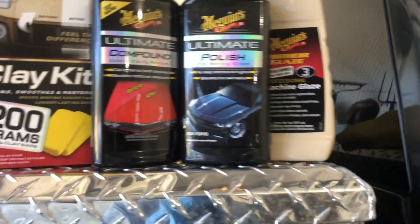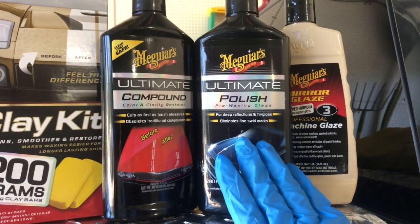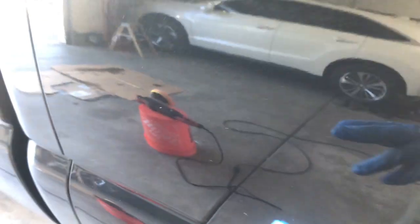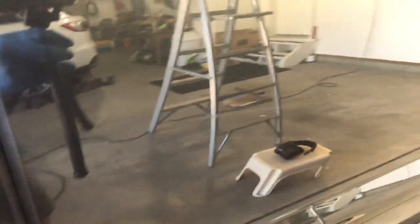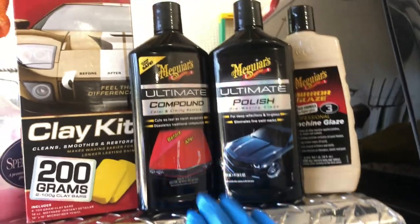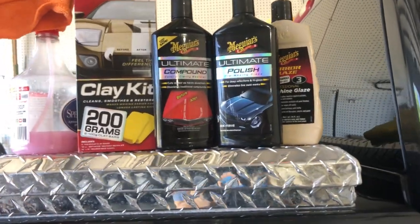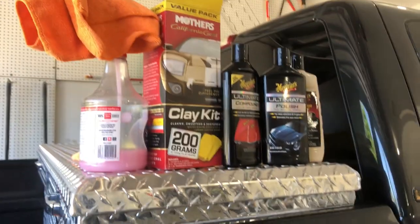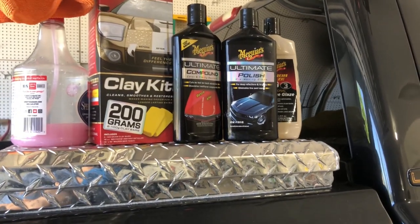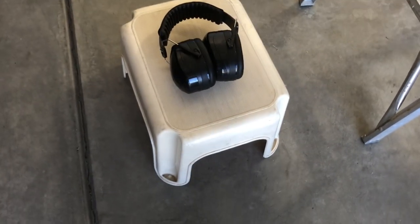There's also heavy cut and stuff like that for really bad scratches, but this truck is in pretty good condition so I've mostly just been doing polish over the whole thing. But if there's a place with a really bad scratch, like right here, that's where I might want to use some compound first and then go to the polish and then the wax or the glaze. I can put links to those products in the description — I might have my Amazon affiliate account running by then — and if you do use the link it would give me a commission, I'd appreciate that but no pressure.